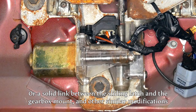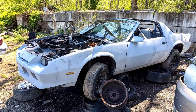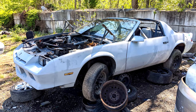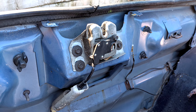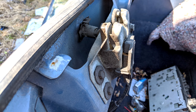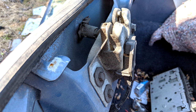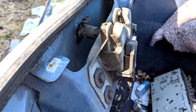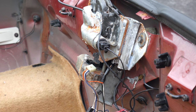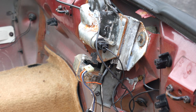I've also heard of people using a screw to lock the motor shaft in place if the gearbox fails. Some early third-gen F-bodies do have a manual latch assembly, like this 1984 Camaro we found in a parts yard. I'm not sure exactly what would be required to swap one of those into a later model - it would probably just be easier to lock the pull-down mechanism in place. So if absolutely everything else fails, we can keep those modification options in the back of our heads, but first we'll try to fix the electronic lift.